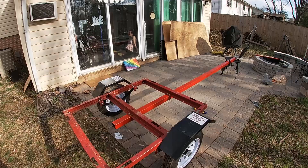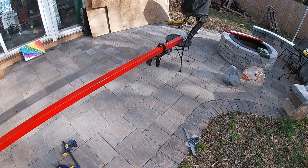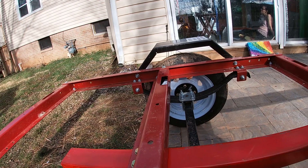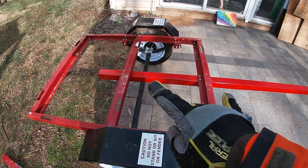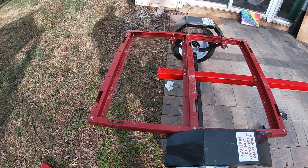I came off the high of getting everything assembled and those holes drilled so easily, only to realize I assembled the tongue backwards. Typically on a leaf spring, the front side should be fixed and the back side floats — and I put this on with the front of the trailer wrong. It would be easy to fix, except the hole pattern on one side isn't the same as the other. So I'm going to have to take it off, drill at least four more holes, and bolt it back on again.